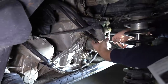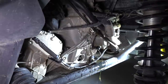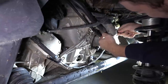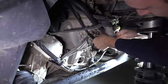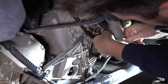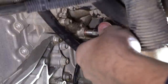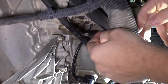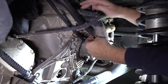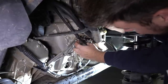Is it still just leaking everywhere? Still leaking - man. Every time I touch that hose it's going off even more. Get that in there. It looks like it's Dex Cool - look at that orange color. Looks like a 10 millimeter. Simple enough - it's pretty easily accessible compared to other installs we've done. Some engine temp gauges use something that goes in-line with the coolant hose where you'd have to break it loose and lose a ton of coolant or cut a hose and put a fitting in. So I'll get a 10 mil and tighten that down.